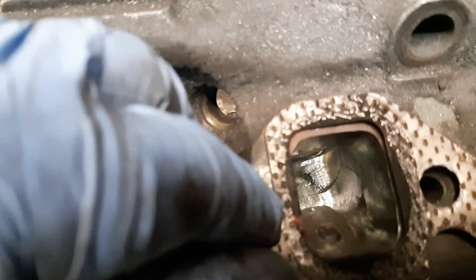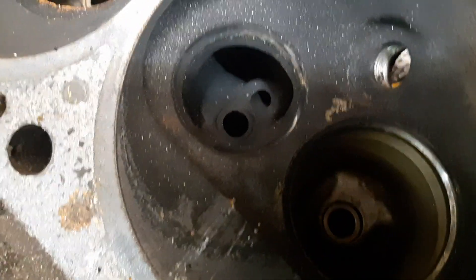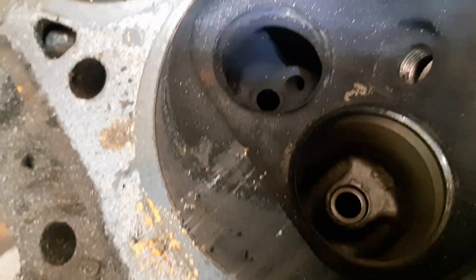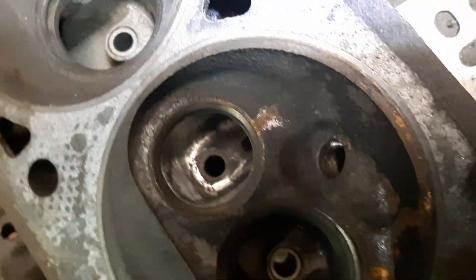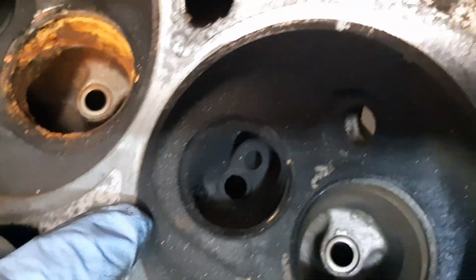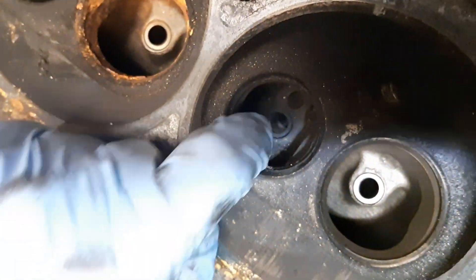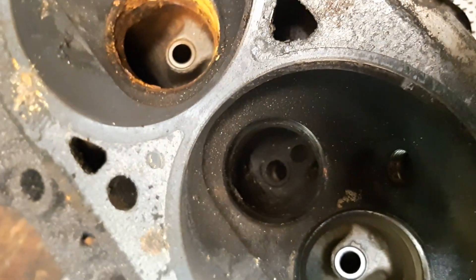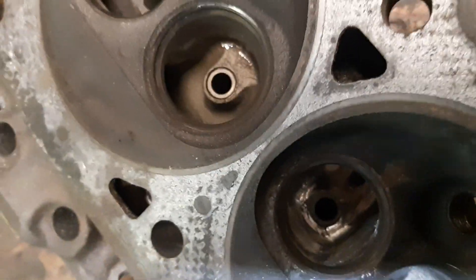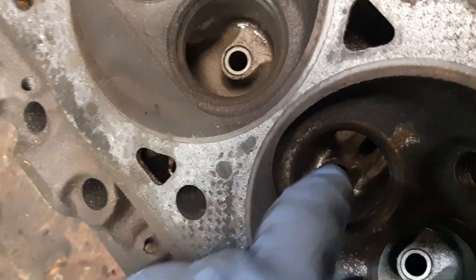Left the bottom of the exhaust port there as well. So there's the exhaust port originally, and there it is afterwards. Opened it up, smoothed out a lot of these edges, made that a better transition. Took out as much as I felt comfortable getting to the valve seat. Tried to smooth out where the valve stem goes, and smoothed out beside where it goes.